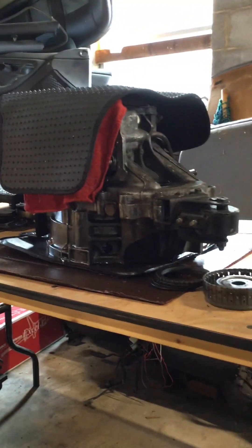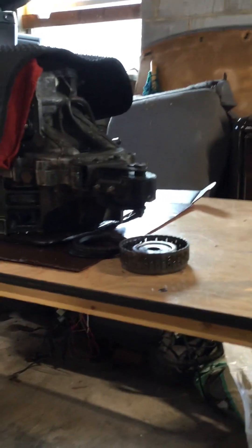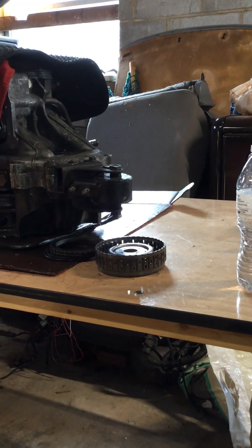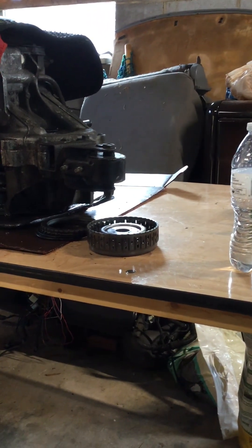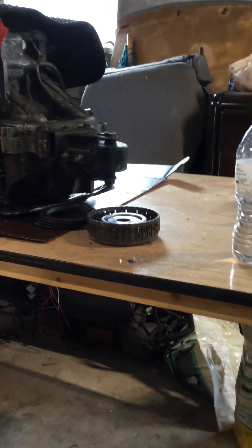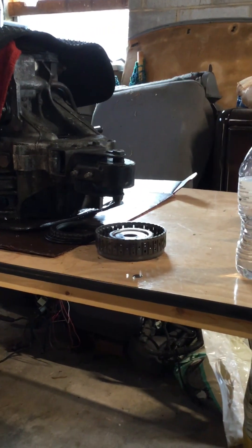When she raced it this past March, the clutch drum — that's the three and four clutch drum — I adjusted the accumulators on three and four and it did not like the adjustment due to it having too much pressure. It came on too fast and ended up pushing the piston sideways in that drum. So I will not be reusing that drum again because it has a few hot spots and could potentially be warped.